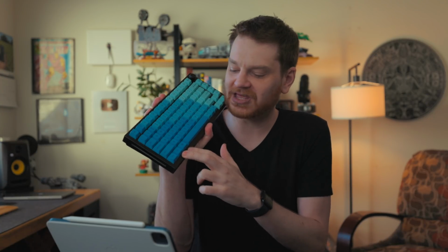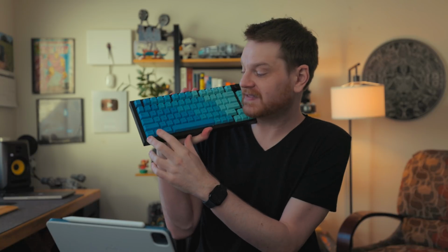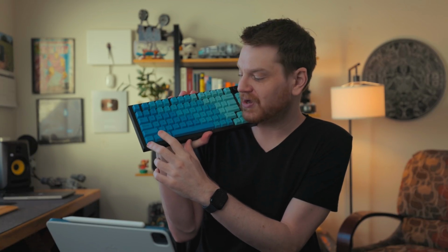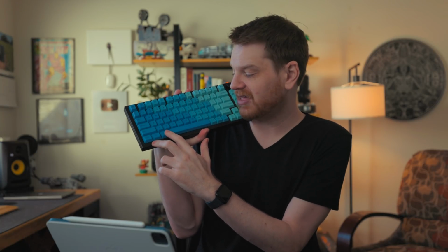The other thing you have to do is go into Mac OS, System Preferences, Keyboard, Modifier Keys, and swap the Option key and the command key spot, because since this is a Windows keyboard, technically it sees where the Alt key is right now as the command spot because that's where the Windows key is, and Alt is Option on Mac OS, so that's technically next to the spacebar on this keyboard. But if you go into the modifier keys, you can swap them so they're in the traditional spot. So Command is next to spacebar.